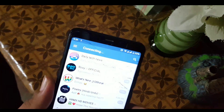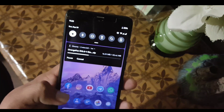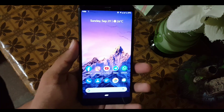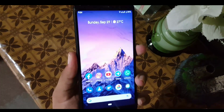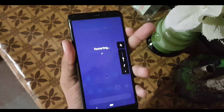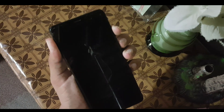After downloading the ROMs, you should have Orange Fox Recovery installed on your Redmi 5 — it will never work on TWRP Recovery, so make sure you have Orange Fox Recovery installed. If you have not installed it, you can watch the video from the link in the description. After that, reboot your device into Orange Fox Recovery by pressing and holding the power button plus volume up button.